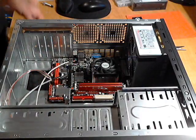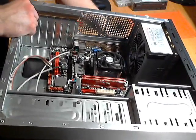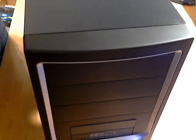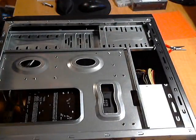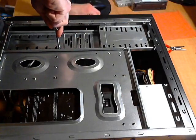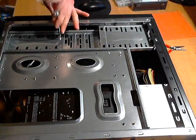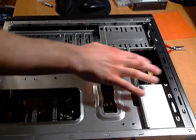I need to put the other two screws in but I have to take the back side panel off — there are two screws that hold it on, and then it slides off. That's the right side of the computer. The holes line up here so I just put the screws in so the hard drive doesn't move at all. You can also see the back of the motherboard, processor area, and power supply from here.